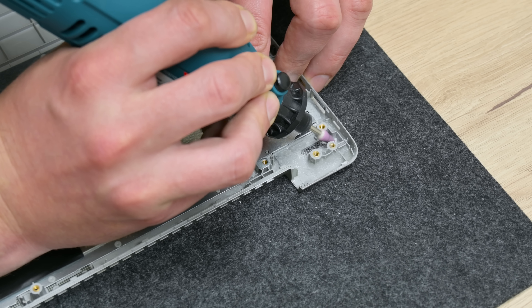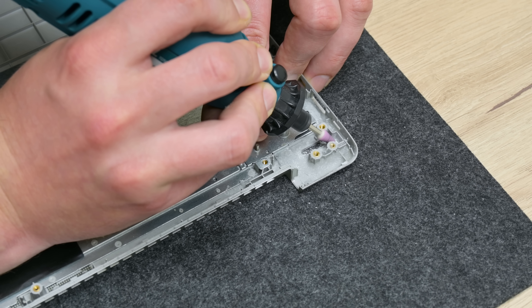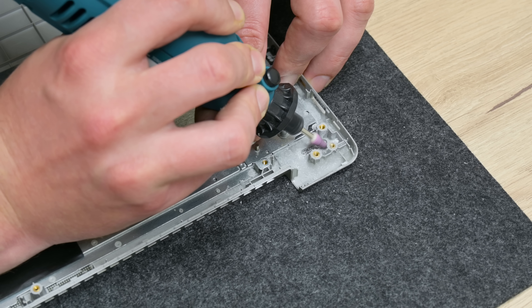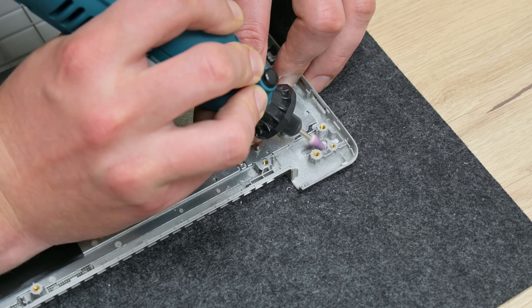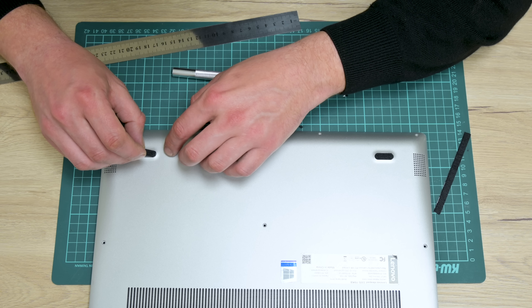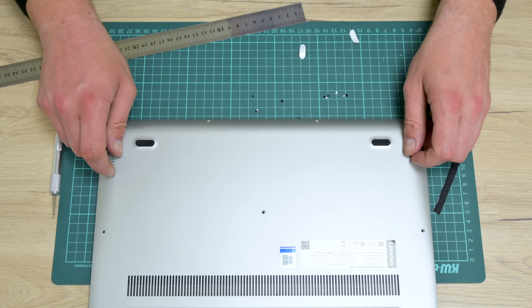Again I use the Dremel to make some adjustments to the parts, and I want to check the quality as well. The quality seems pretty good, and the baking soda in combination with quality superglue has done a good job here. In addition to the bottom case, I added two missing pads, so now the laptop won't lay directly on the plastic, and the aesthetics are a little bit better. And finally, this machine is ready to assemble.